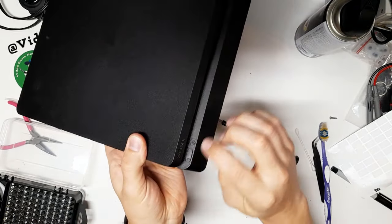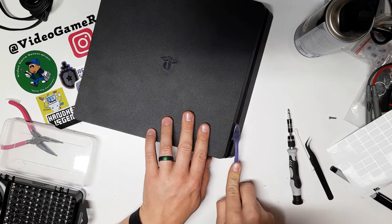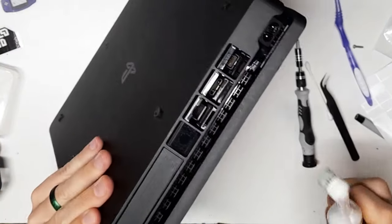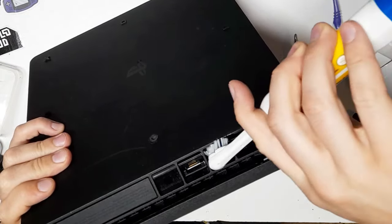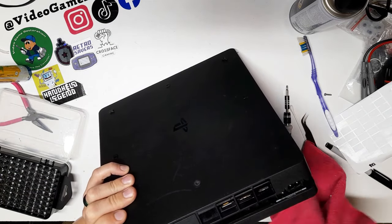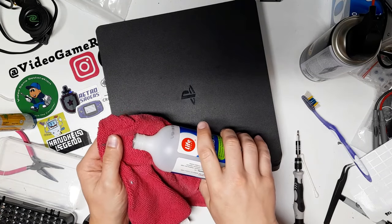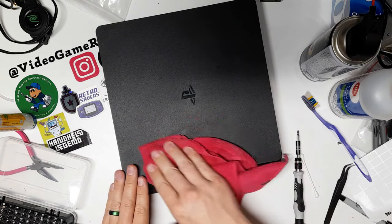Now there's a little bit of dirt in the buttons here, so I'm just going to clean that up with a little bit of isopropyl alcohol. I'm also going to clean up the little Sony symbol, and then using my electric toothbrush I'm going to clean out the HDMI port, just to ensure it's nice and clean and functional. I use 99% isopropyl anytime I'm cleaning electronics. You don't want to do that very hard because you don't want to damage the port — you just want to clean it up. Whenever I'm cleaning something that isn't an electronic and it's plastic, I'll use 70% isopropyl alcohol, because it's a little easier on the plastic, and I just try to avoid any electronic components when using this.